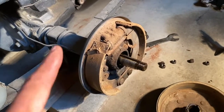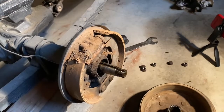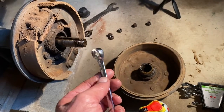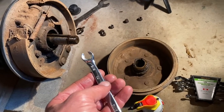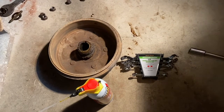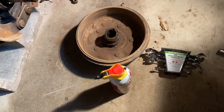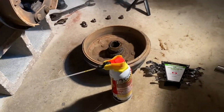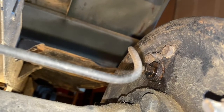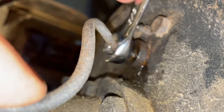The next step is to detach the brake line where it attaches to the slave cylinder in the back. Only use a flare nut wrench — this is a three-eighths size. Don't use a regular wrench; you'll strip it out, especially on these old vehicles. Pittsburgh makes a cheap set — about ten bucks for the whole set at Harbor Freight, or see the link in the description. Don't force anything — these brake lines will twist and bend and you'll ruin them. I'm going to try it first; if it doesn't pop I'll use some penetrating catalyst. I prefer Blaster. Had to spray some Blaster — just a little too tight — there we go.